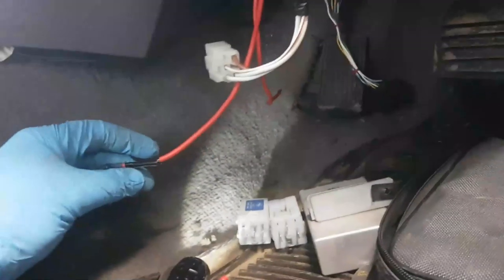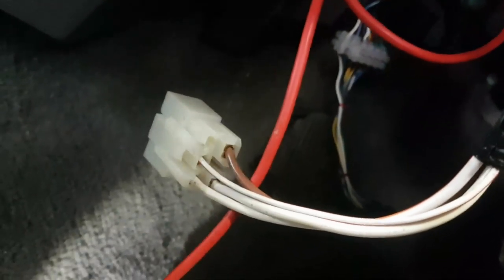A few moments later. Find the connector right up there, wired in, 12 volts to it, nothing. So if I earth this wire, and then this wire I'm plugging into, I'll get nothing. Absolutely nothing. Circuit's there, motor's doing nothing. So this heater needs to come out, I'm afraid, chaps.